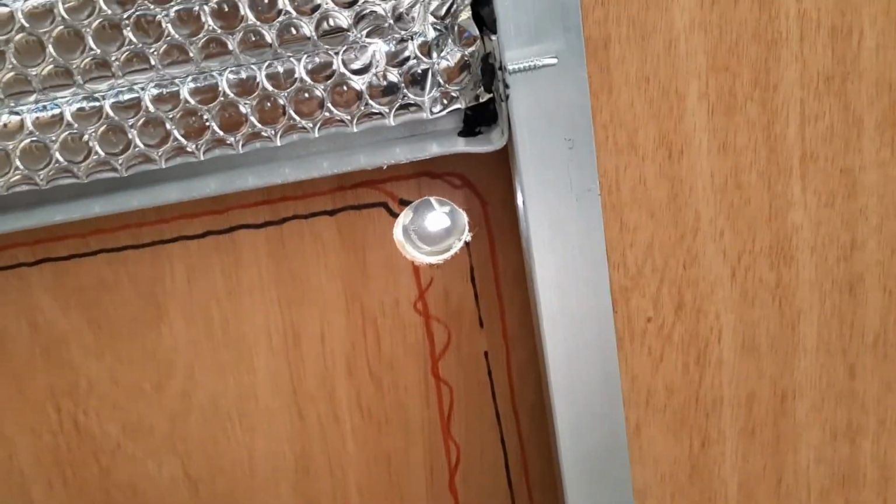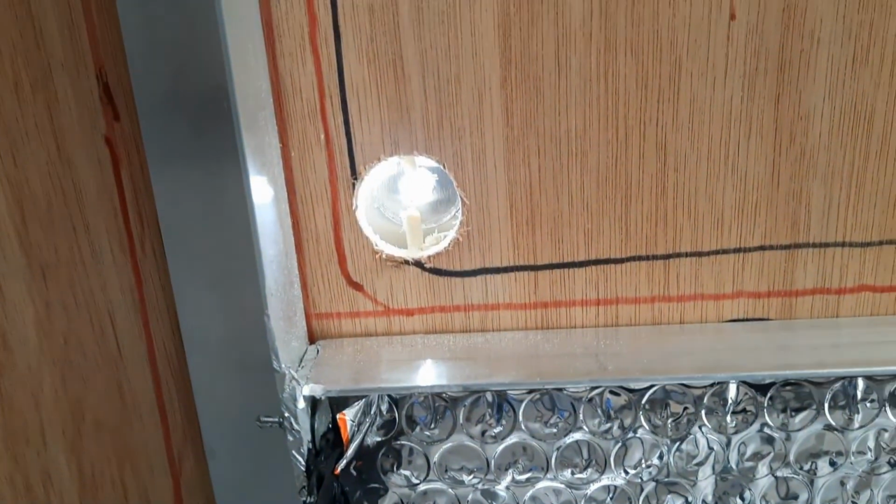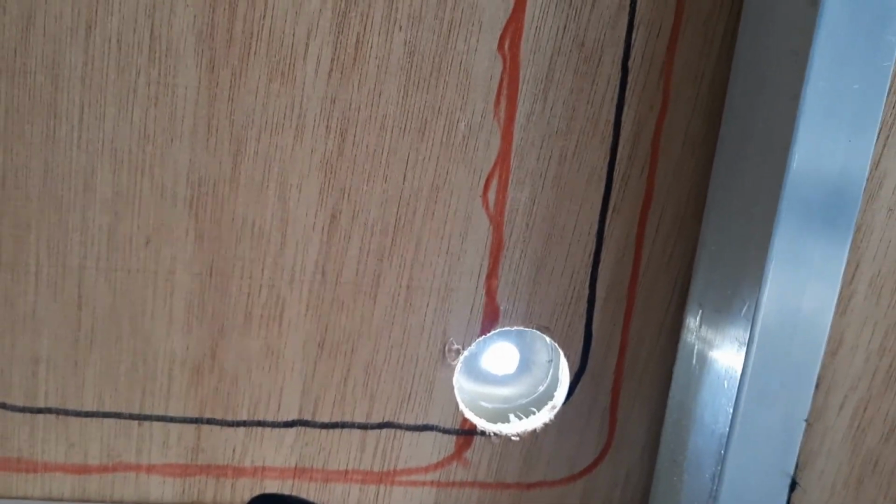Got my 4 corner holes drilled, and then what I'll do is go up, finish them through the aluminum, and then take a jigsaw with a fine blade and connect the holes and clean up the aluminum and drop the fan in and screw it in.